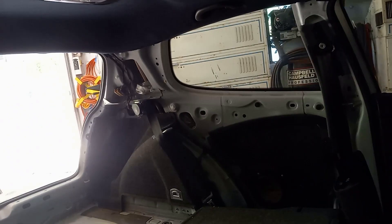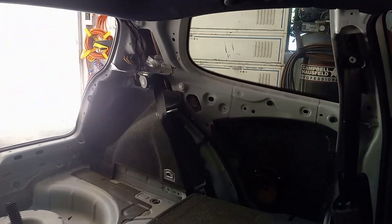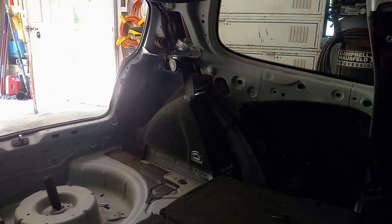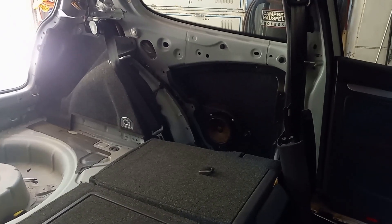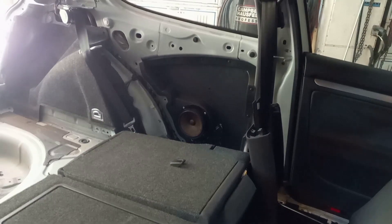I had to take a lot of parts off to do this, including the back seat and trunk board. There are little tabs with screws behind them that pop out with clips, and the back one pops out the same way. The bottom of the seat has trim panels that pop out with clips and a screw, and the trunk liner piece has about five or six screws. Most of it is just clips — take your time and it's pretty self-explanatory. This is also what you'd need to do to access the speakers back there.